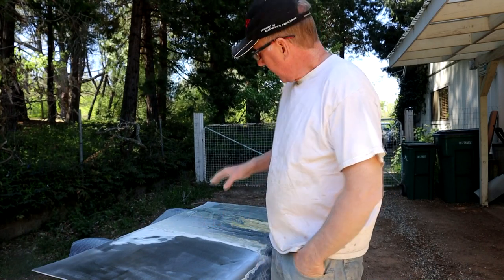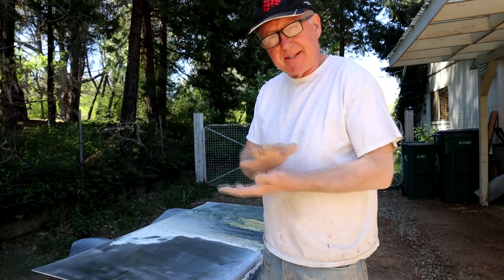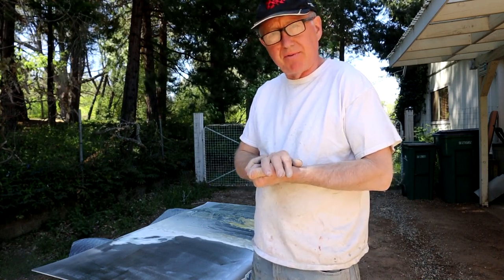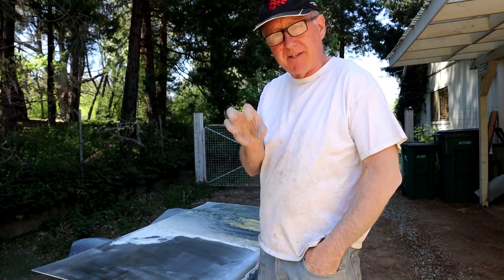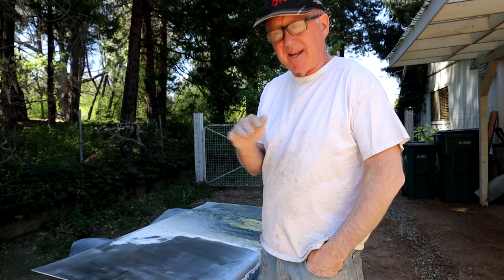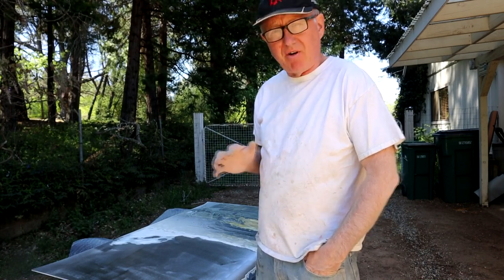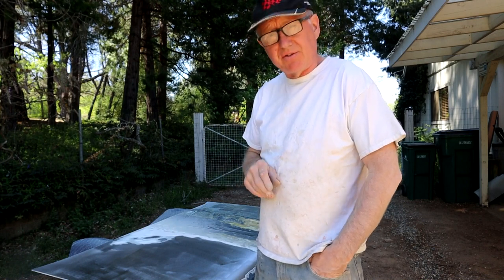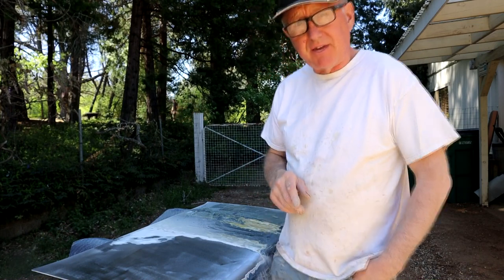It's still a little slow to really start to soften that main blue paint before you can get down to the white. What I find works better is using a DA sander with aggressive 80 or 60 grit paper to break through that clear coat layer, to enable the stripper to really start biting. That clear coat is incredibly tough — break it off with an aggressive sander and then apply the stripper; it seems to work better.